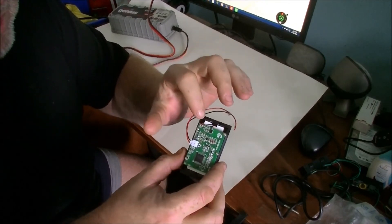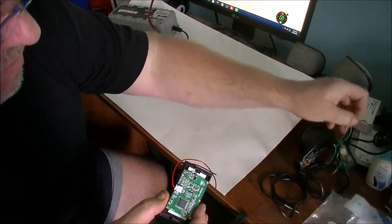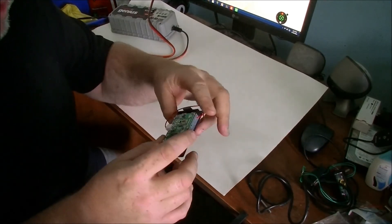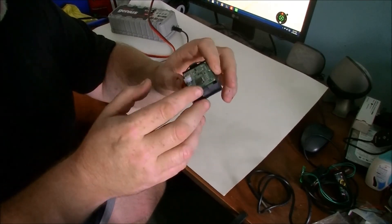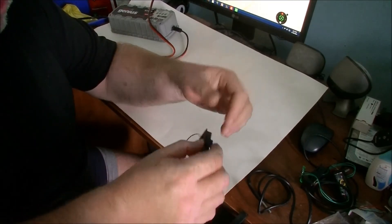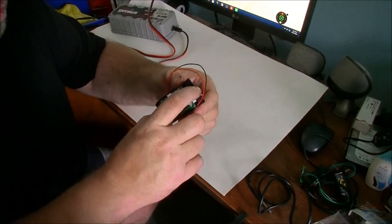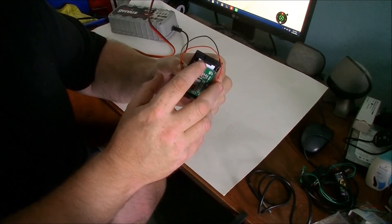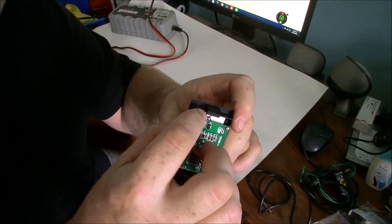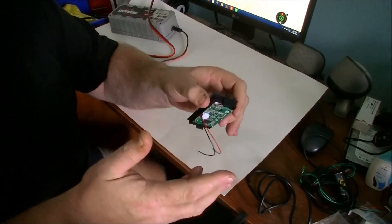You can put in a little switch — if you're into electronics, find a small momentary switch so when you press it the light comes on. Otherwise that LED or incandescent light will burn out in time, so it's not something you want to keep on when the vehicle isn't running. Hook it up so it only works with the ignition. Also, when making your hole for this particular unit, give a little extra space for the clip here — it won't push in otherwise, so cut a little more so it fits properly.